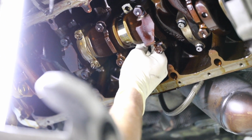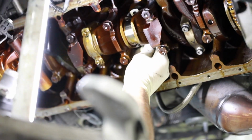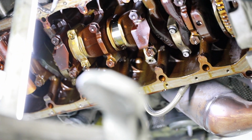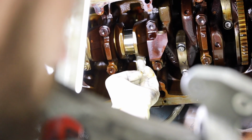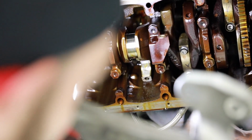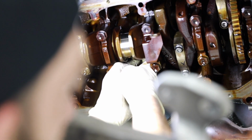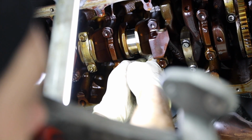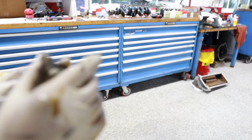So once you've pushed it up, maybe an inch, maybe 2 inches, something like that, just enough where the connecting rod can now swing past the crankshaft. So now, see, here's your connecting rod, just nice and loose. You can reach the bearing shell. And here's where it gets a little tricky. You almost have to get 2 hands in there and pop that bearing shell out of there. Very gently. Wow. And here's cylinder number 3.